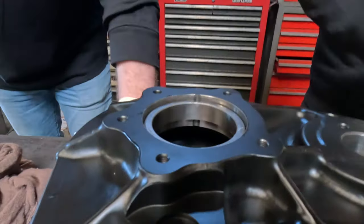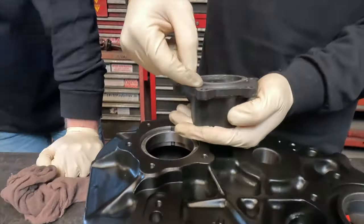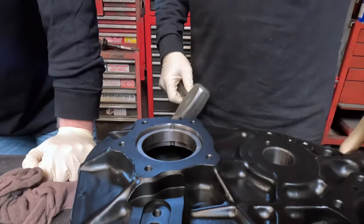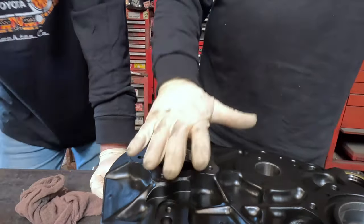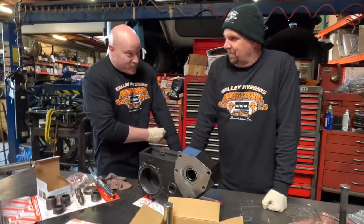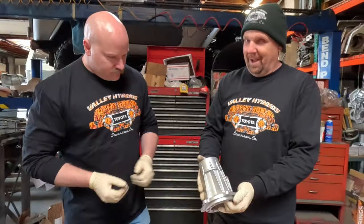Realistically, this needs to be about a quarter inch down from flush, because this step right here is how far it's going to seat. I always like pushing it through a little further. So when the gear set goes in there, the gear set pushes against it and then pushes it into place. That's about all we can do on the transfer case for now.